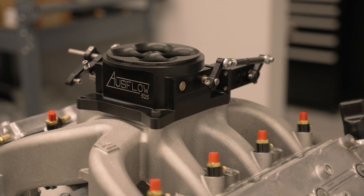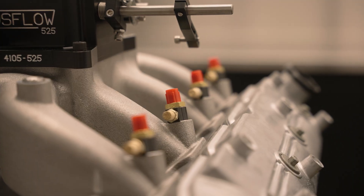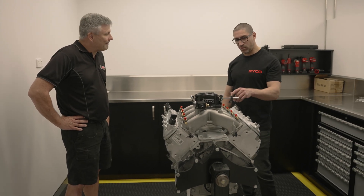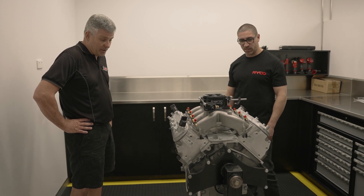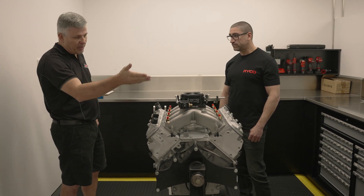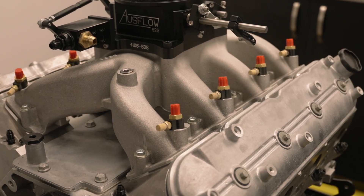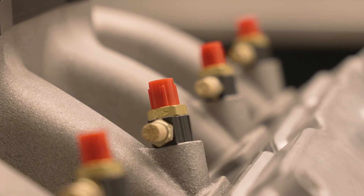The lap times are only about half a second off the big engines. That's like a CT525, which GM make - it's a circle track engine, 525 horsepower on petrol and about 590 on alcohol. It pretty much looks like a Commodore engine aside from the intake, methanol setup, and everything. It's got a camshaft, a circle track sump, ATI balancer, methanol injection with an MSD box. It's limited to 7,000 RPM. It's a good budget engine, and if they hurt it, it's a quarter of the price to fix. It gets guys into speedway without spending the big money on the 410s, and they can move up if they want to pursue their driving career further.